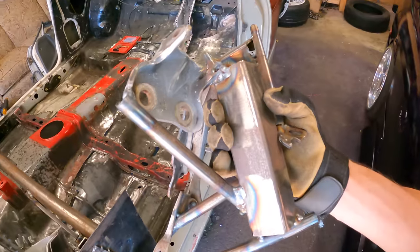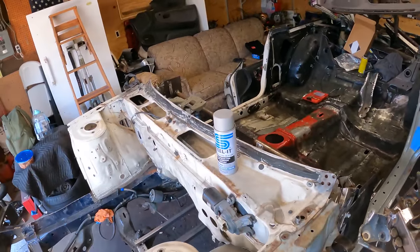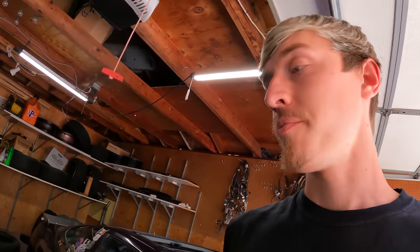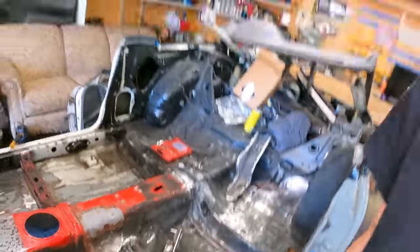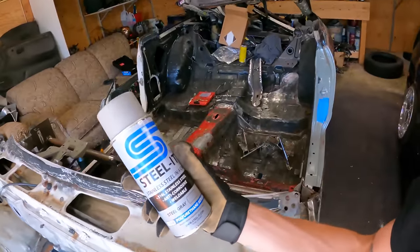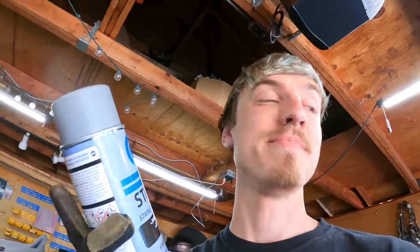Today is an exciting day. In the last video we left off making a mini jig to line up the A-pillar and the firewall, so I can bolt the firewall onto the car and know it's in the correct spot. But before I put these jigs on — one on each side — I want to spray weld-through primer on all the bare metal on the car, because we are nearing the fun part: welding. My goal today is to hopefully get something welded on the car.